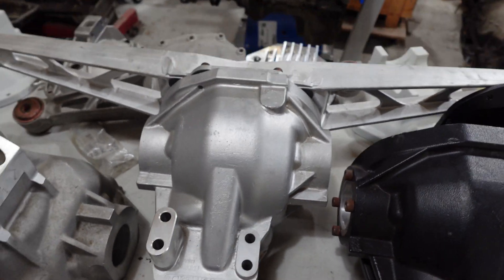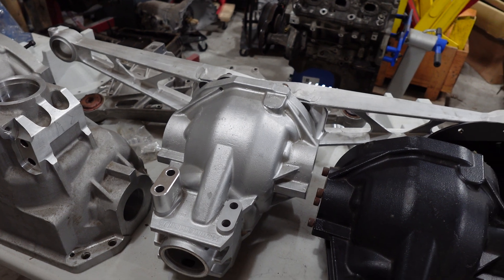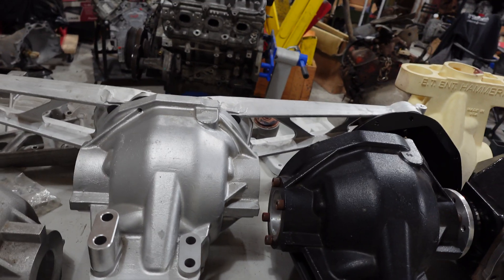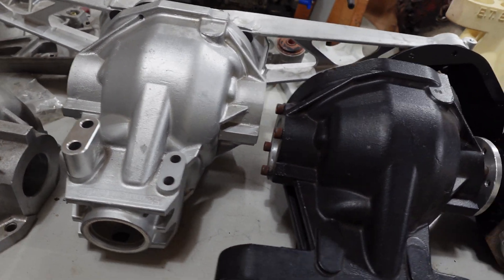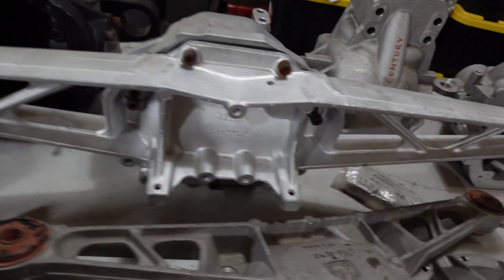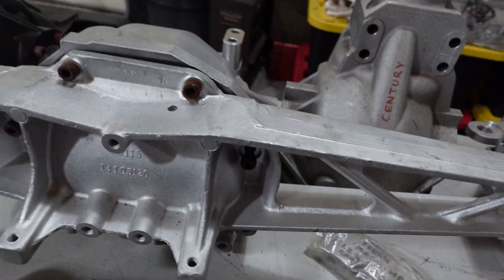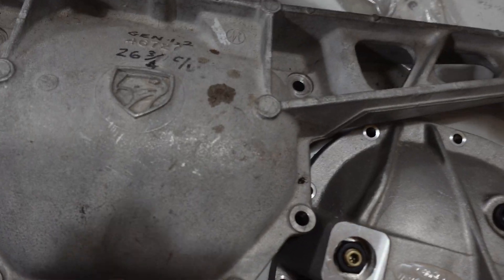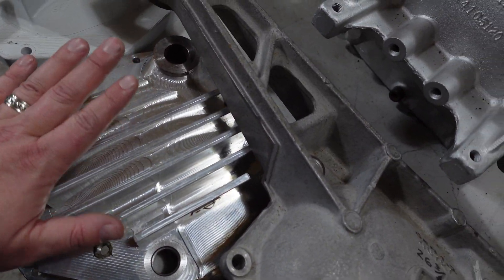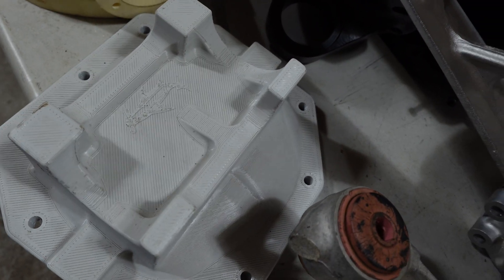Here's an example of a C4 Corvette application — we've got this little add-on piece of billet to stack on there so it'll bolt in. We had this in some custom chassis and we're still kind of testing this. We want to go to a CV axle instead of the driveshaft-style axle. The C4 and the Viper use the Dana 44, so this will bolt right up to the Dana 44 batwing. Here's a Viper one and here's another test billet unit.